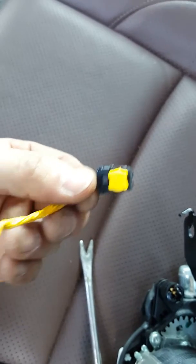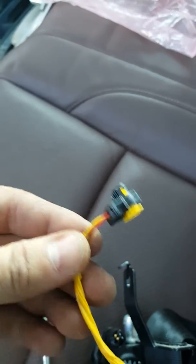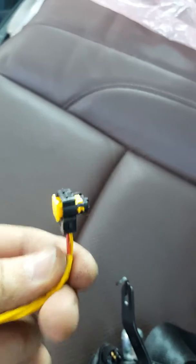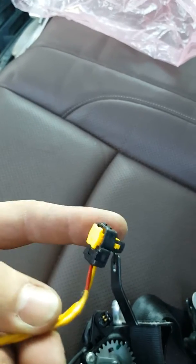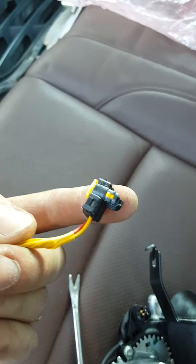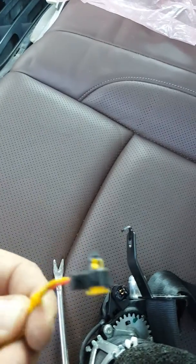This is the same plug that you have on the steering wheel airbag. So if you have to replace the seatbelt and the airbag, I suggest that you keep the plug and reuse the end for the airbag, because once the airbag deploys in a steering wheel, your plastic ends will melt. I don't know why, but I guess it creates so much heat that the ends melt into the steering wheel, so you have to get new plugs.